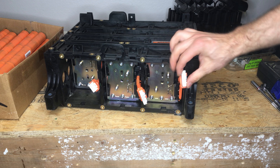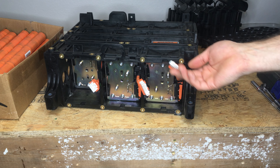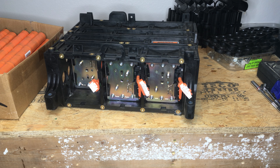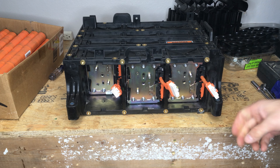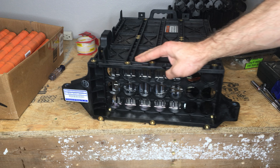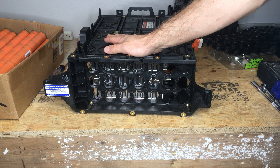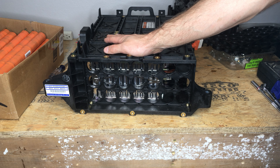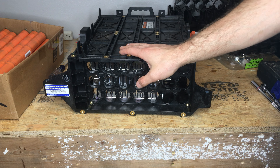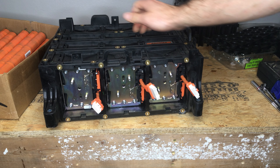These connectors will basically just have a PCB that they plug into, and from there what more could you ask for? This is an OEM solution — it's not even permanent. You could actually go back to nickel metal hydride if you wanted to. This is a 5 amp hour, 200 volt conversion for the Insight, with all the mechanicals basically just requiring a couple of end plates.